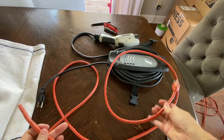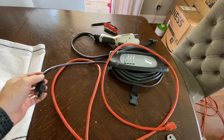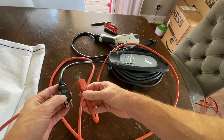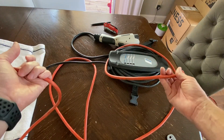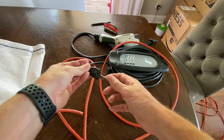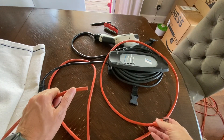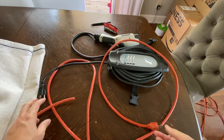One thing to note: the longer you make an electrical cable, the more resistance you're going to have. So if you were looking for the most efficient way to repair this, you would just clip this off and put on a plug — you can buy them at Lowe's or Home Depot. I don't have one today, so I'm going to use the extension cord. I'm using the longer section because I think this failed in part because it got hung from outlets under its own weight. While we'll lose a little efficiency in charging, it means it'll never have to pull on this plug. Worst case, if I want it shorter, I can always cut it shorter and just do this again.